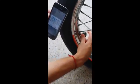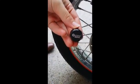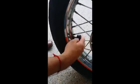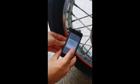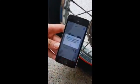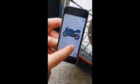Now I'm at the rear tire of the bike. I'll remove the sensor from the tire valve, wait for eight seconds, then screw it back onto the tire valve. Hold your phone very close to the sensor and tap OK. You'll see the instruction saying 'release completed.' Click OK, and you can see on the app that both sensors have been released.